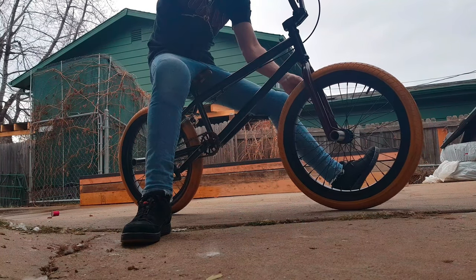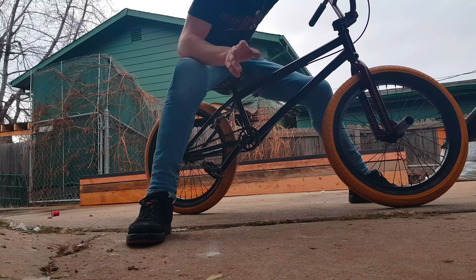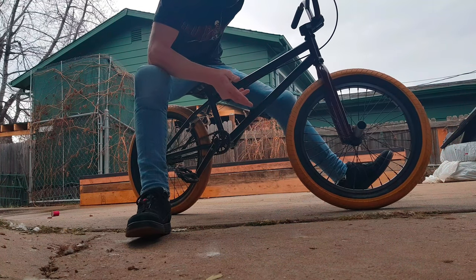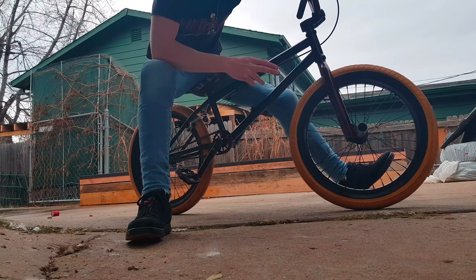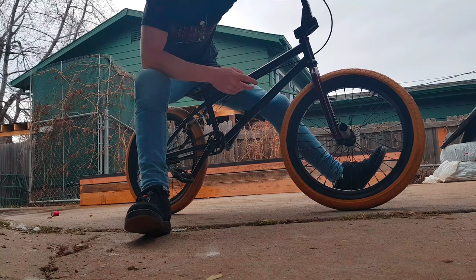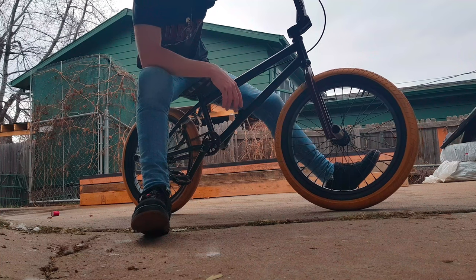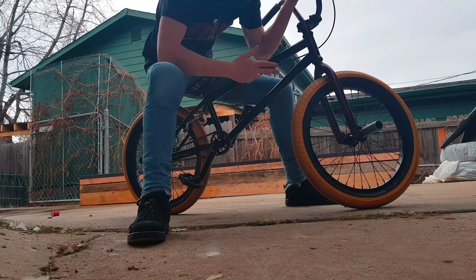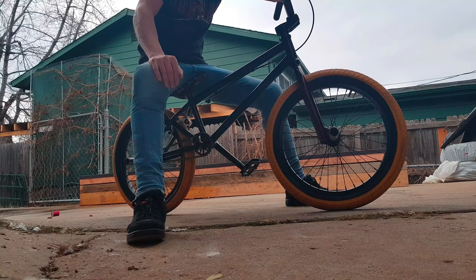I don't see any negatives to this bike — it's incredible for the price. Even at the full retail price, the 2018 is easily the best deal. Full chromoly everything. The only parts that are questionable, like I said in my last review of the 2018: the front hub is unsealed — meaning it's loose ball bearings instead of a cartridge bearing — but it's still sealed from the elements, so dirt and stuff is not going to get in there. It is a female hub though, so that's an improvement, since the front was unsealed and unable to take a peg before. The fork is a little bit spaced far, and that's been the case on both. The stem is pretty questionable quality-wise but it works. The headset on the 2018 is a slightly smaller size than standard, so you won't be able to just pick up any bearing set — you have to get a specific one, I'll list it in the description. It's a great bike for the price, even at the full asking price.